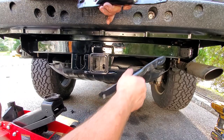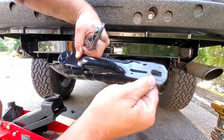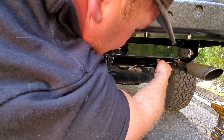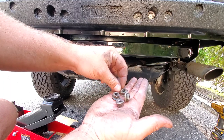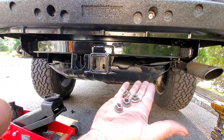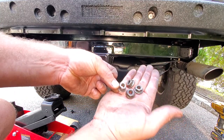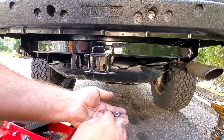Last thing to secure the skid plate onto the hitch — I'm going to put on our little crossbars here. I put some electrical tape on there and they're just going to go in like that. Get them in place. I've got four 15mm nuts. I used one of these to install the sway bar on the Black Beauty so I had to find a spare — doesn't match, but it'll have to do.